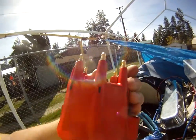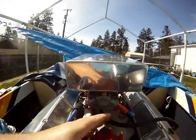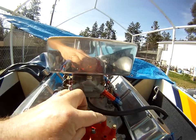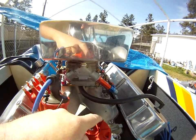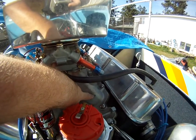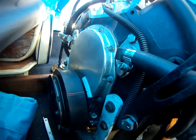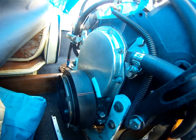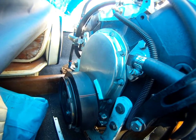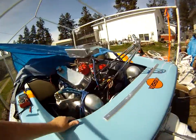I've marked number one cylinder right there. If I turn my distributor so that the spark plug wire is facing exactly at number one, the rotor is pointing right there. I've put a mark on the rotor and a mark down here on my intake manifold so I know I'm at number one. The way I verify I'm at number one cylinder is that I've brought my timing marks on the harmonic balancer to zero. I need to make sure I'm not 180 degrees off with my cam — take your valve cover off and make sure both valves are all the way up when you're at top dead center, pointing at number one cylinder.